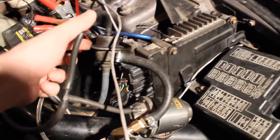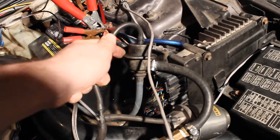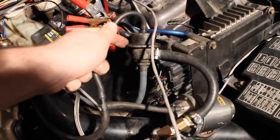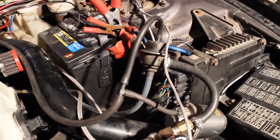Adam gave me this — it's off an old turbo Dodge — so it should add 1 psi of fuel pressure for every psi of boost that it sees through this reference here. That should keep my fuel nice and even in boost.